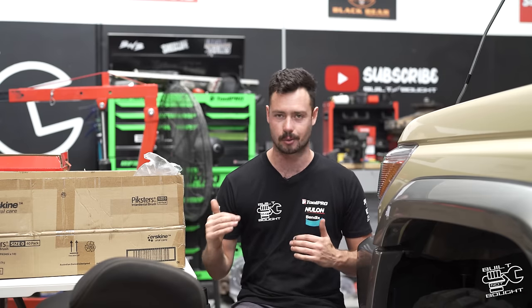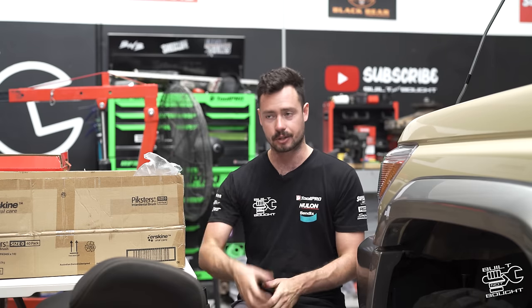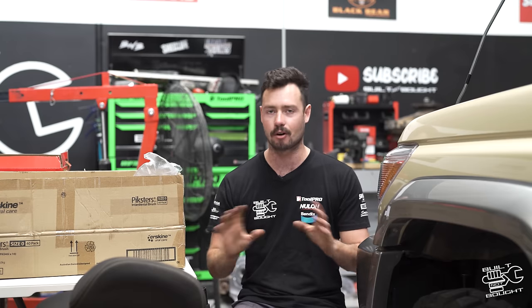This is one of those things - I have painted a lot of cars before, but this is next level sort of bodywork. I had a literally custom front end shape, so I had to mold the thing. It was a lot of experimentation using foam, fillers, bog, and fiberglass matting and all sorts of stuff to get the shape right. I redid it about two or three times, same with the back end. The rear ended up being steel because that's staying there permanently. The front - we got a complete mold made, so I had a full custom bonnet and guards all in fiberglass. The whole front end is now full custom fiberglass to suit that 200 series shape.